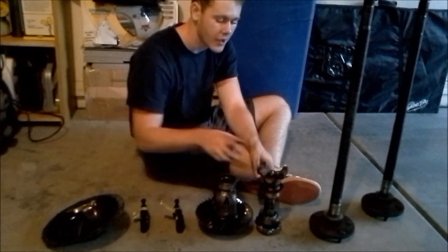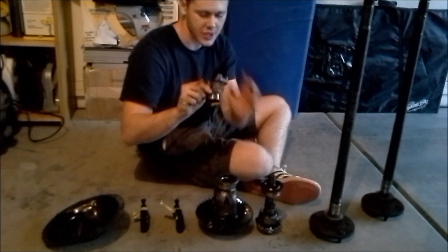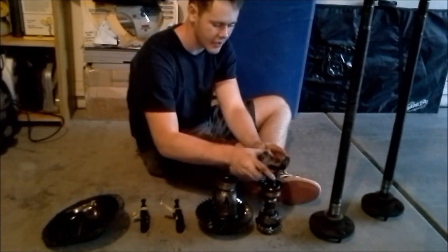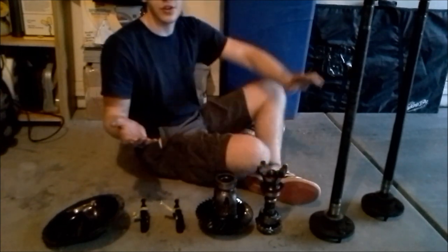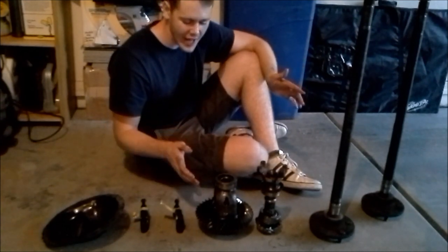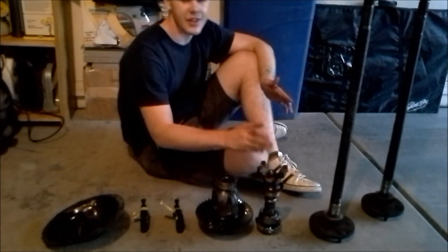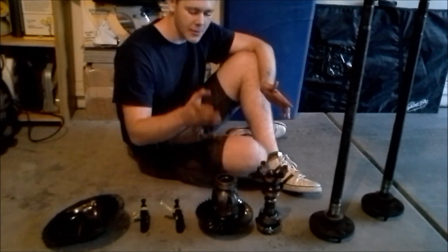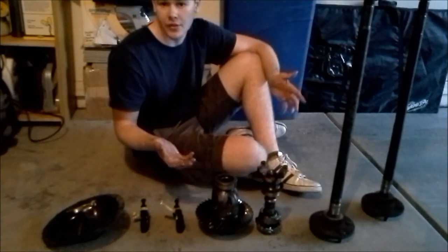Here's the yoke that attaches to the drive shaft — this is what connects the drive shaft to the pinion gear, and this is the nut that holds it together. If the previous owner changed your gear ratio and didn't tell you what it was, you can figure it out by counting the number of teeth on your ring gear, then the number of teeth on your pinion gear, and dividing — that gives you your axle gear ratio.